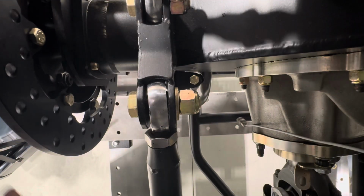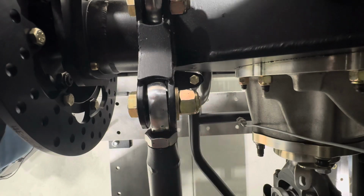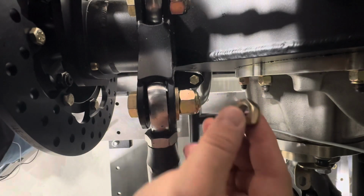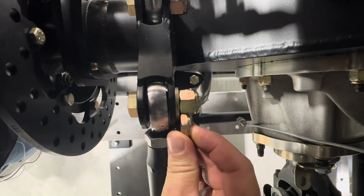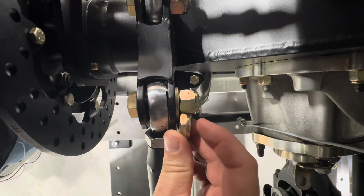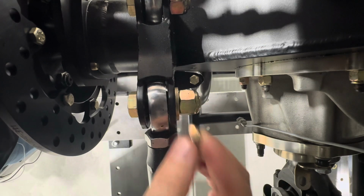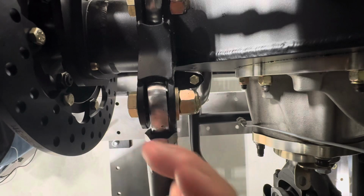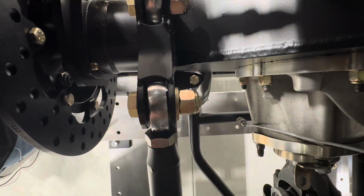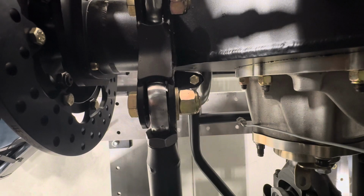Okay, that looks pretty good. Again, the bolt is all the way through. The other option, like we discussed before, would be to put the low profile nut on there. Sometimes I call it a jam nut, and you maybe turn off some of the threads. Either way, functionally, it's going to be great this way. There's no end play back and forth, and yet we do have the grip length in the right portions. You're going to apply the same principle to all of these.